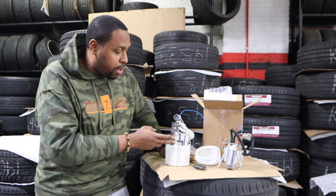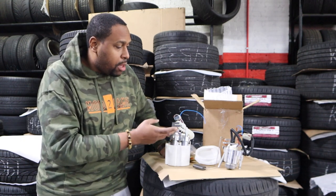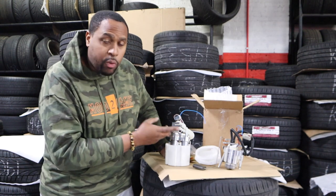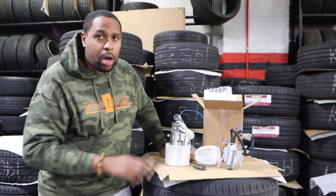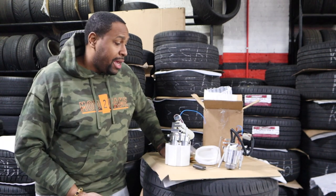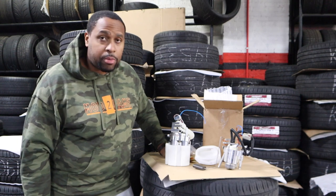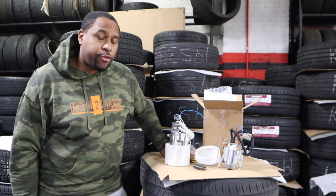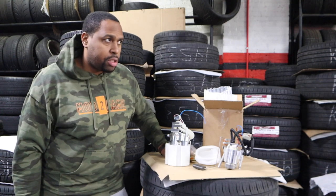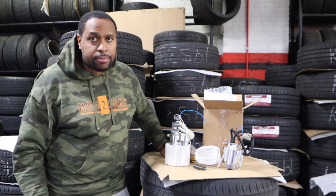I can't say enough about the benefit of running the Steve White dual pump system with a basket — I wouldn't do anything else. I sure can't see myself upgrading to a four or triple pump because a four or triple has the same issue: it's not in the basket, so if you get fuel slosh you could starve the pumps anyway.